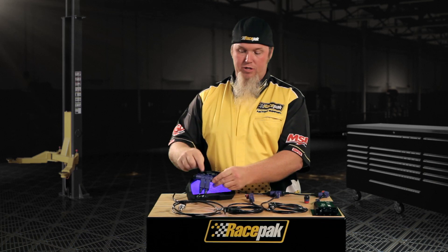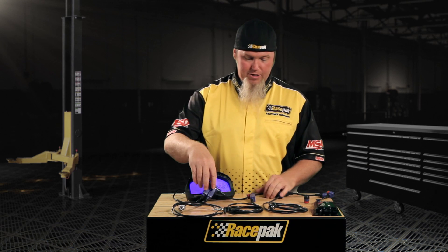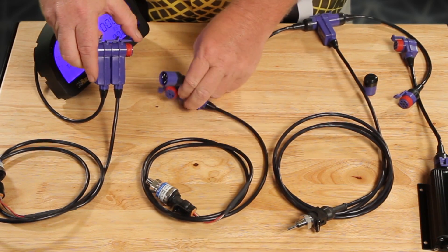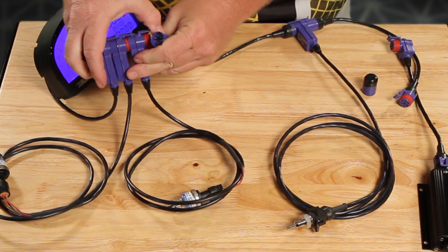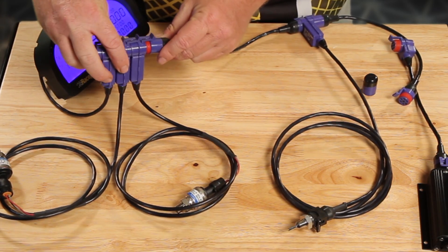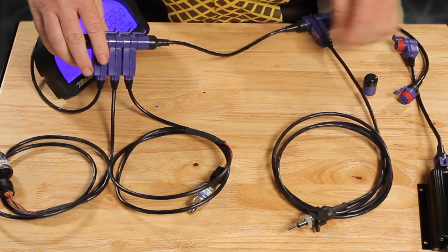Now if this is the front end of our cable in our vehicle and it's empty, what do we do with that? Easy — small weatherproof connector caps that just snap on, just like any cable. Now as we come along, we decide we also want to put a water temp gauge in. We need to add that sensor, so we disconnect and plug a new one in. It's literally that simple — no longer having to re-fix a harness because you forgot something.